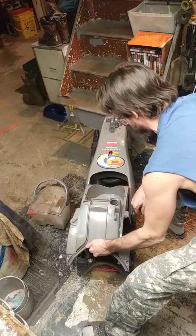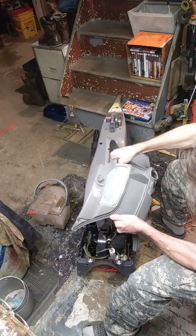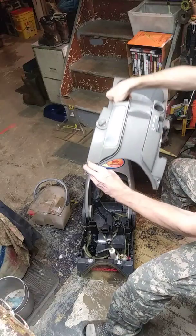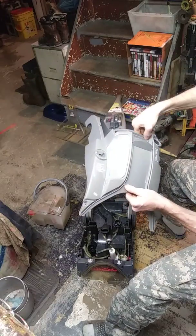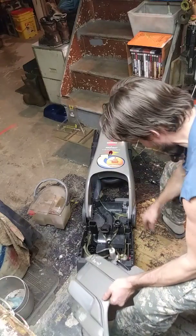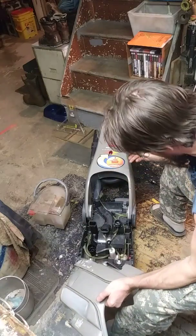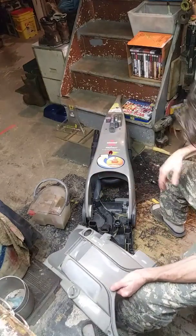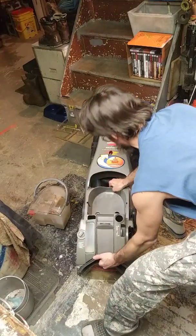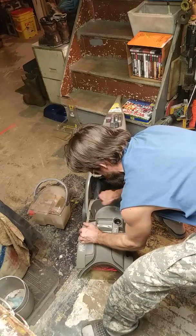Again, it's just pretty much the 2 screws in the back, 2 screws in the middle, and then the rest is all snapped together by the front piece that is these 2 screws. If you're going to do this, you're going to want to vacuum and clean this out real good. Even if crud is back here, what happens over time is that if it gets loosened up, it'll end up sucking into the motor or wherever, and just clogging something else up. So that's what I recommend. You don't have to, but that's what I like to do on this farm. Might as well, the way I always figure it.